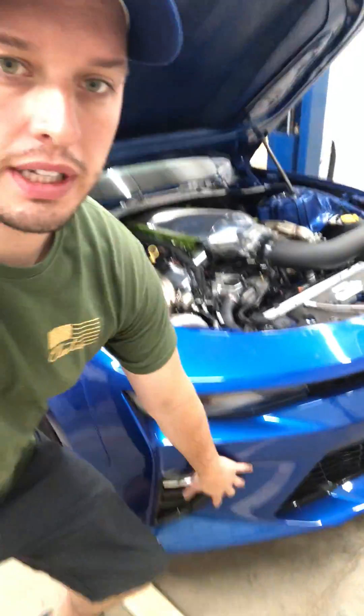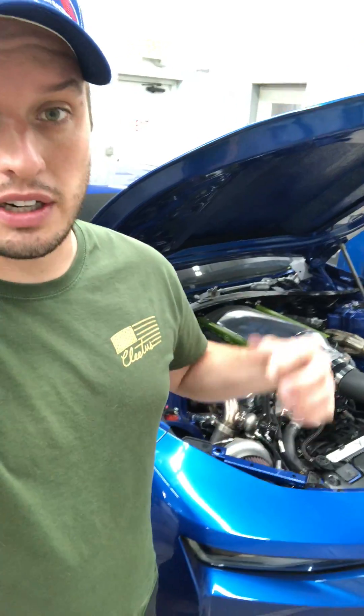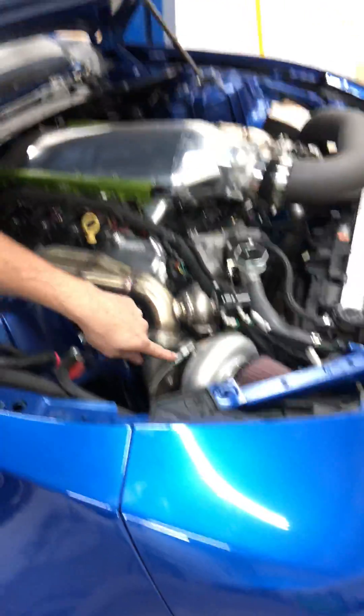It has been a tremendous help, fixes a lot of people's issues, and it's free. On the blue mule the turbos are mounted up high so they're able to gravity drain oil — that's fine. A lot of guys are mounting them low these days, either in the trans tunnel on new cars and old cars, and that's fine. We sell a lot of scavenge pumps, that's what you need to get rid of the oil. But they say their turbo seals are bad, it's leaking, starts up and smokes, leaks when it sits. The oil feed line on the blue mule is actually going uphill, so when the motor shuts off the oil drains back — there's no pressure pushing it forward. This turbo has zero oil-in issues, gravity drain, everything like that.